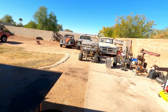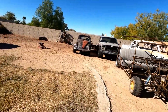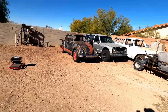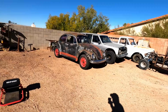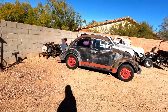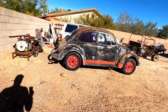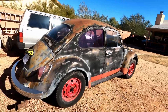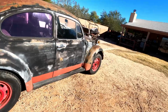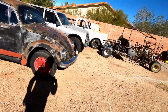Black Betty is going to be a very cool car, because we're going to lower it down. I think that's going to drop it a couple inches there. And it's real easy to drop the back if you shift the torsion plate there a couple of notches to get it down. But it's not far from being down now anyways. It's pretty soft too. So anyways, those brakes are going to be going on.